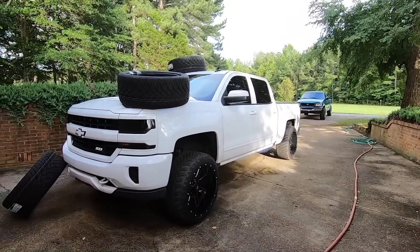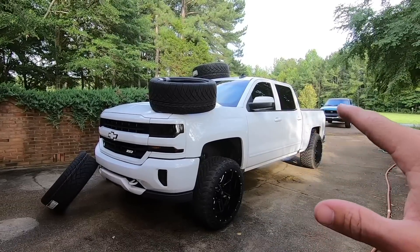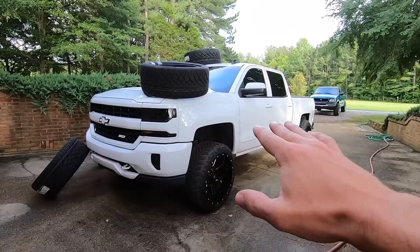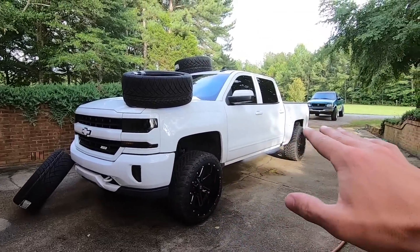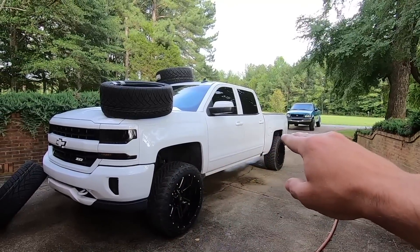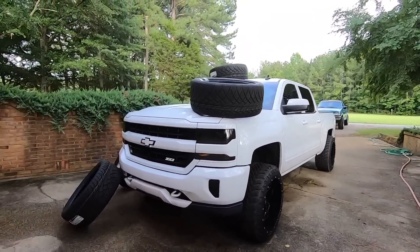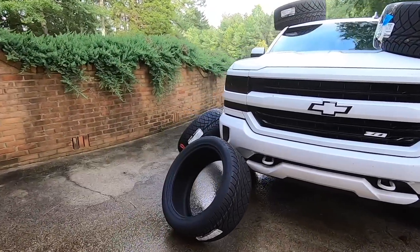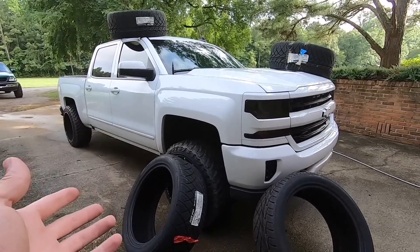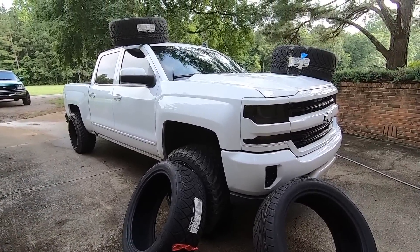For quite a while now, since I bought these about six months ago, I've been really debating on changing the suspension setup on Baby Squat. We've rocked the three-inch level in the front and then multiple different rear end setups over the last two and a half years. I've been debating dropping it in the front back to stock — not slamming it, just back to stock — and then doing two-inch drop shackles with the rear block removed. That would leave it basically leveled, slightly raked, with the rear probably just a touch taller. Then we'd throw the 305-40-22 Nitto 420s on — the low, wide-ish look.